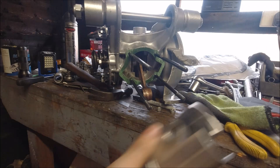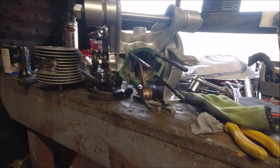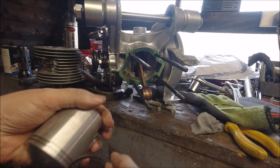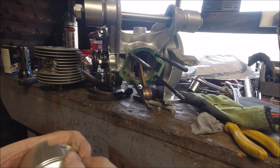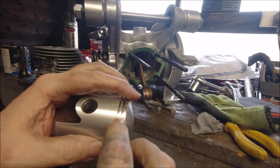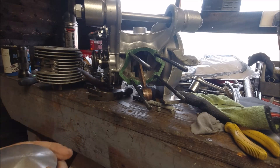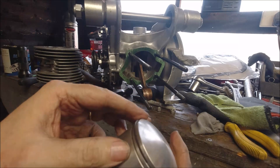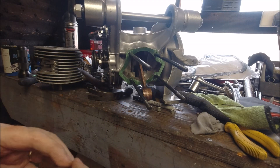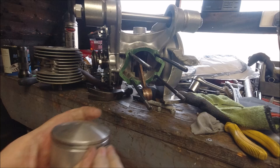To do that — which is probably in every single how-to book ever made — you just open them up with your thumbs, looking for the ring grooves, and just literally take your time. Pull them out and over on the ends. Don't push them, don't use anything too hard, because these can be very brittle, and they often slip into the groove of the one before it, which is a nightmare.